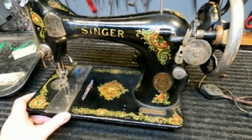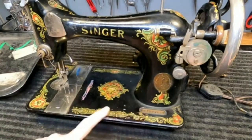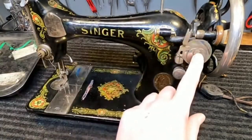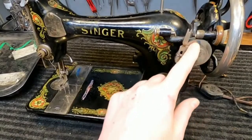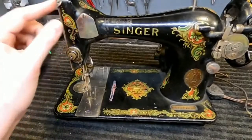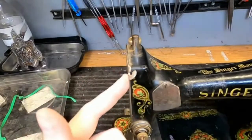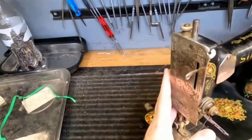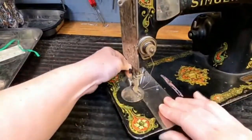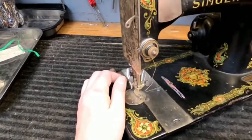Now looking at this machine — this is a legit customer machine that has come in for restoration. You can tell it does need a little work. I will say the decals are actually in really good condition; for a 128, I don't normally see them this nice. It does need some attention — there's a little bit of buildup and dirt, which I don't worry about. You want to start looking all over the machine. Here's an issue I just noticed: this thread guide is bent out of place, so we're going to have to fix this by bending it back, but that's not catastrophic. It does have the needle plate and needle bar cover. It does have all the plates, though they may be hard to slide.